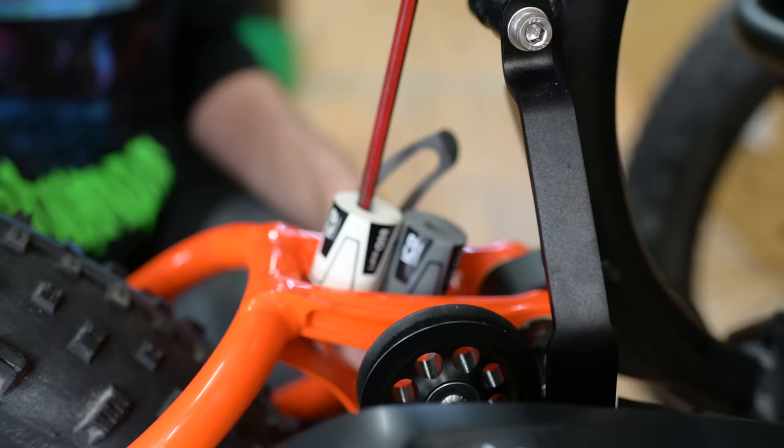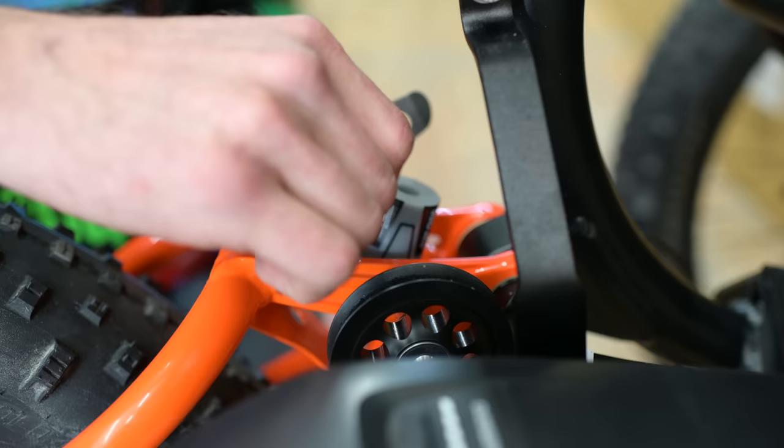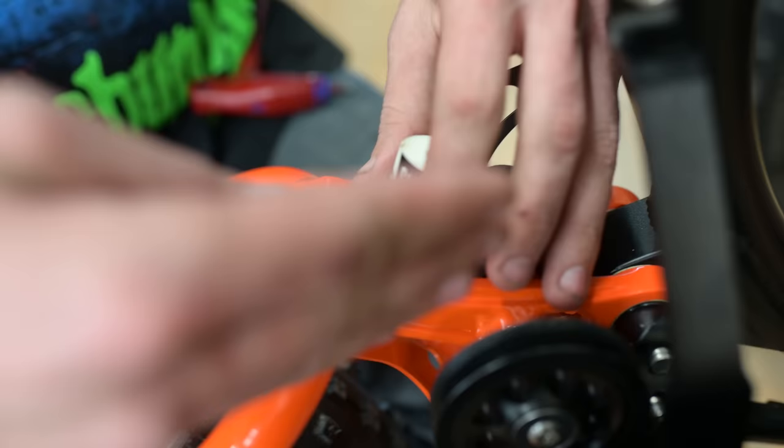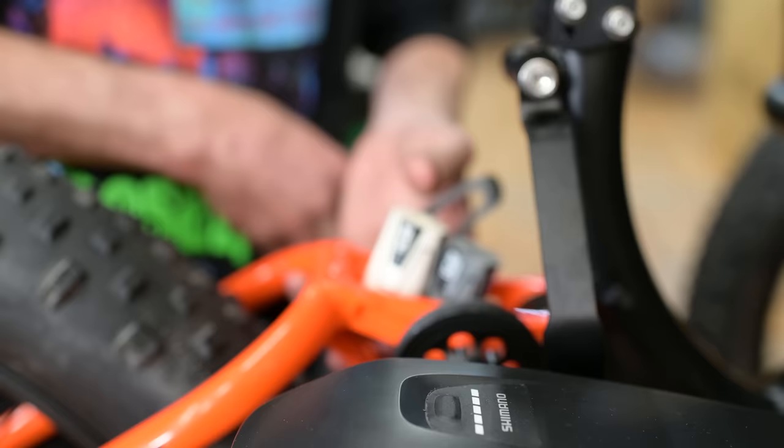There is a 6 millimeter bolt head inside of these. So loosen that and spin the elastomer out. Underneath the elastomers, you'll see four holes. You can move the elastomers either forward or backwards to adjust the preload. If you move them forward, you will have more preload, which will make the ride a little more stiff. So yeah, the full fat is gonna be a really smooth ride.